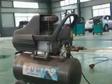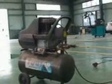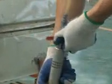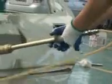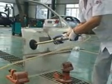Panel trick sucker. When the car body has a large dent, you can use the panel trick sucker function. First, connect the sucker with the gas pipe. Put the sucker on the dent part and turn on the gas switch on the sucker. Then, pull the hammer hard till the dent is formed. Finally, turn off the gas switch and take off the sucker.